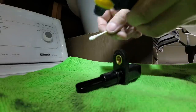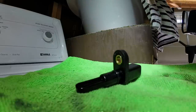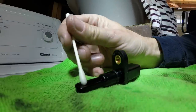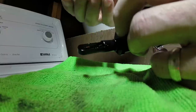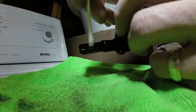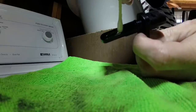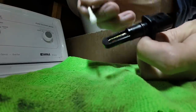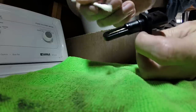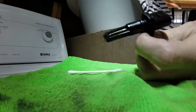If this is dirty and not giving a clean signal, I have a little spray bottle of alcohol and a q-tip — the alcohol will evaporate. It barely reaches down far enough to get to that sensor, it's super sensitive, but I've never had this cause a problem; I've done this on a few cars. Be real gentle, make sure you've got a clean q-tip. I'm not really getting any dirt on this so it's pretty much fine, just showing you how you might do it if you have a dirty one. You could also use an electronic cleaner spray — that's probably a better idea.